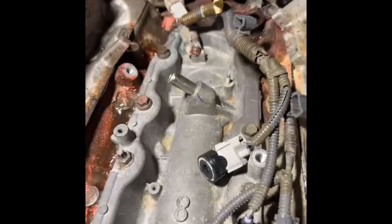The valley plate is in and we're installing the knock sensors now. I want to draw your attention to a little engineering detail Toyota does on this bolt. This one screw holds a bracket — basically a brace that ties the knock sensor wiring harness down and keeps it from vibrating. Notice how the bracket has the ends bent around this casting. Why would you do that? It's so that when you tighten it down, it doesn't twist. You can totally tighten this down with one hand on the tool without needing a second hand to prevent rotation. This also prevents stress on the wire harness. Just those little details you notice when putting something together — that's pretty smart.